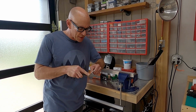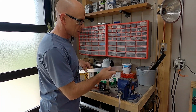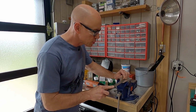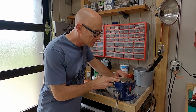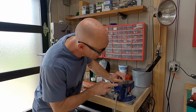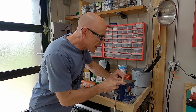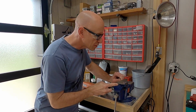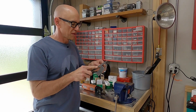So what I've learned is that cutting with this tool is not terribly delicate. I think I actually get a cleaner cut with a hacksaw. So on the RV, we're going to save that tool for just the parts where I can't actually get a hacksaw in there. We'll do the hacksaw cuts first to border up my cuts, and I think we'll get a decent end result that way. So now this bracket is going to be used to hold the forward end of the Super Slider. But we're not going to install it yet. I was just using it to practice cutting.